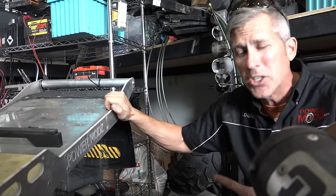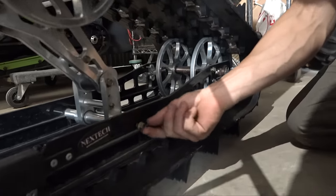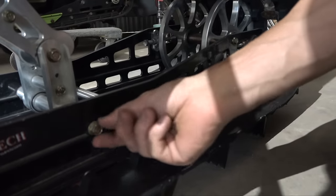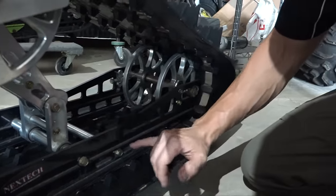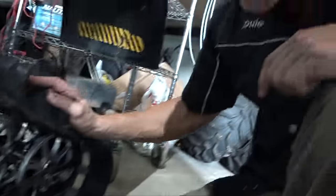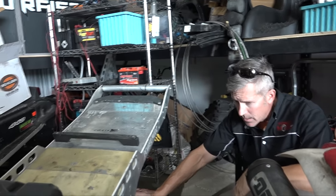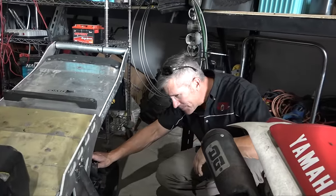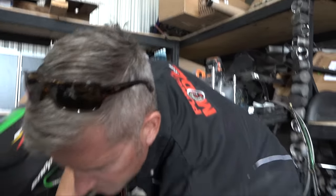Check all your bushings in your suspension — make sure they're all nice and tight, not loose and sloppy. Wherever you see bolts going into these little shafts, get in there and make sure they're snug and torqued to factory spec. They shouldn't be loose and boring a hole, because they'll overbore out of that — and that's not a good day, especially if you're a trail rider or mountain rider jumping off cornices. Also check your main suspension mounting holes and torque those up — we have had those come off before.